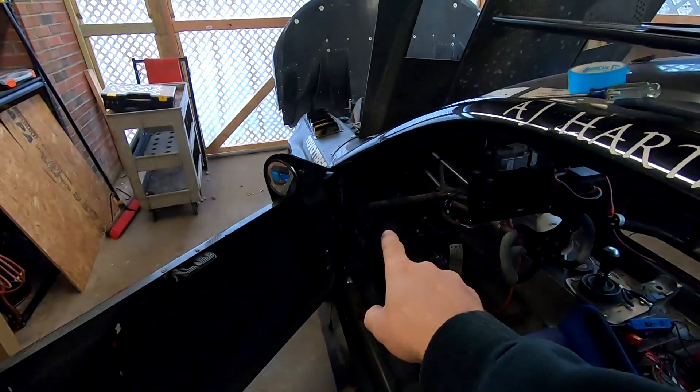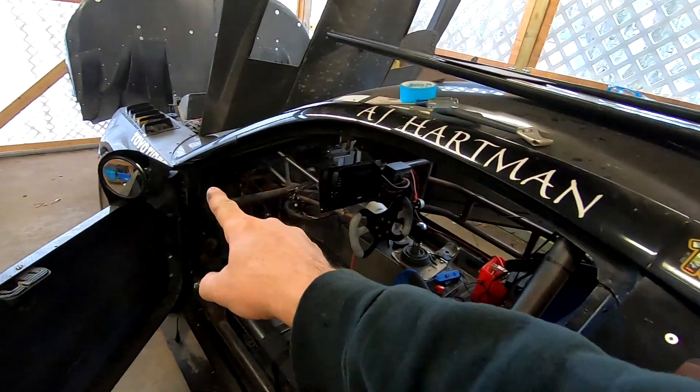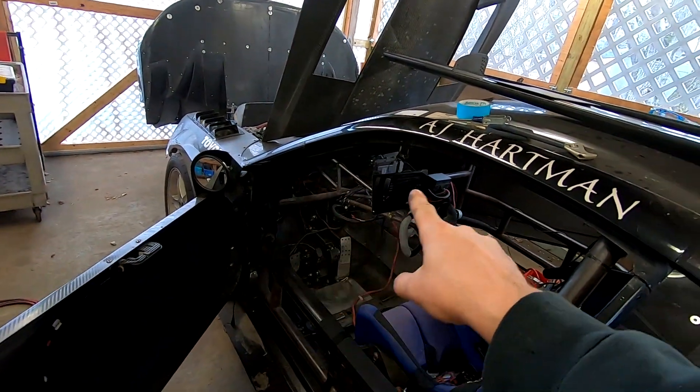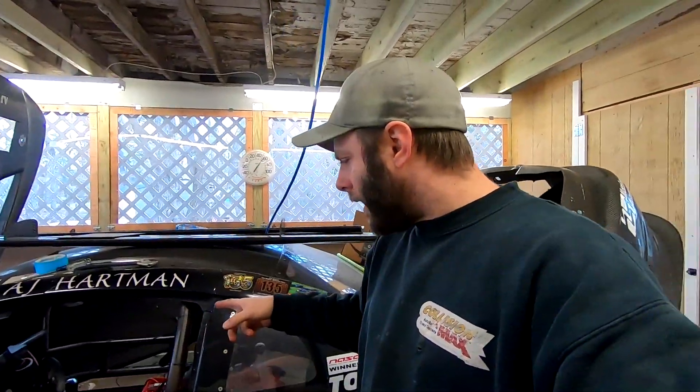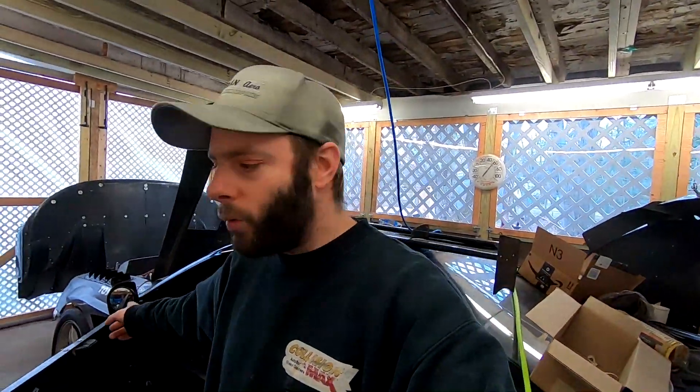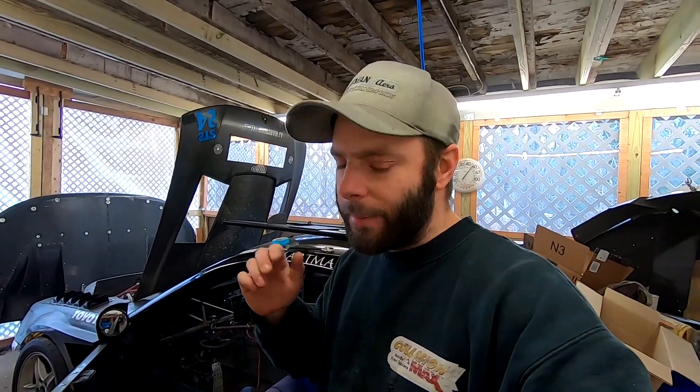Quick update — I'm sure I'm not the only one that starts a project thinking it's going to be quick and ends up getting sucked in. What I'm doing now is moving the cutoff switch up to that corner and putting a pull cable on this side, so the emergency cutoff can be done from either side. Two reasons: it'll get rid of that big zero-gauge wire running all the way across the dash bar and back, and it will save a little bit of weight and clean up the wiring. I cut off the little plate the old switch mounted to and we're going to weld that up and keep trucking along.